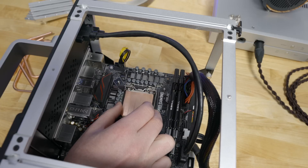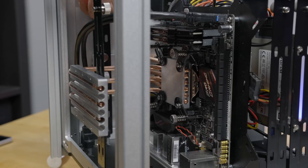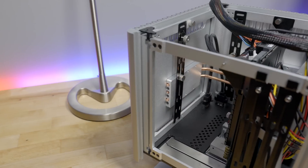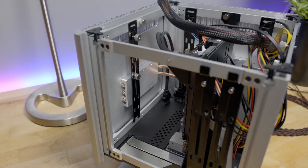This case has no fans, but you might be thinking every computer has fans — so how does this thing cool? A copper shim sits on top of the CPU's heat spreader and draws heat out from the CPU into long copper heat pipes, which then divert the heat away from the CPU to the massive aluminum walls that act as really big heat sinks, like enormous radiators. Despite my doubts, the thermals on this case are actually really impressive, and it looks like a decent cooling solution.